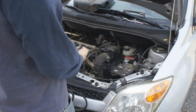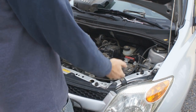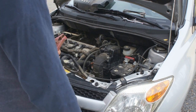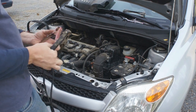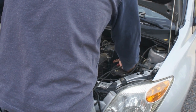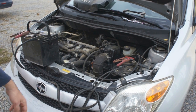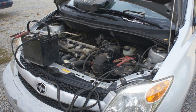Another question that came up a lot in the previous video was how do you charge the Boost Packs? A lot of times I'll just use my power supply or a traditional 12-volt battery charger. In this case I'm just going to use a regular 12-volt car battery. Thanks to the fact that this is a capacitor, it actually charges up very quickly — just connect it up and leave it for a little bit and you'll be charged right up. And of course, if you have a solar panel in your dash, that would continue to keep it topped off.